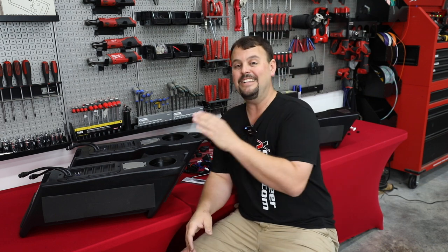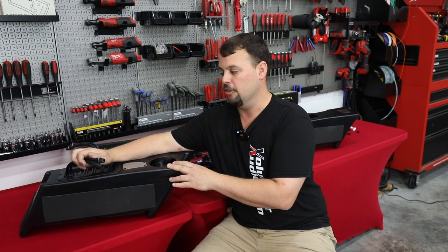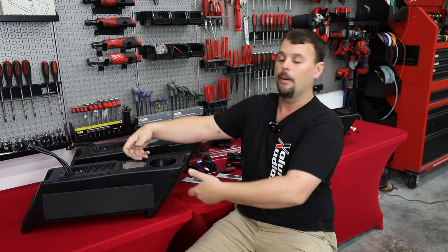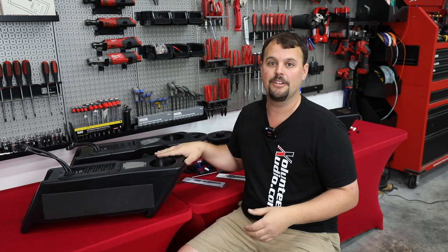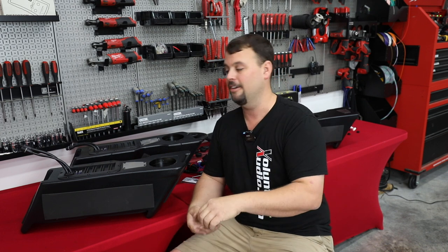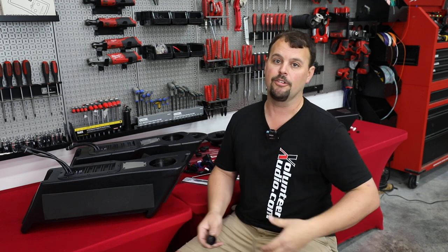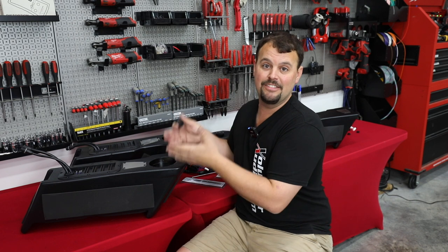On top of all of that, it's very easy to install, and even easier to uninstall when you take one of those long trips. If you're going to take a long trip and need to fill your bag full of stuff, you simply unbolt these two connectors from the side of the bag, remove the two latches — it's just four screws on each — pop that sub out, put your latches back on, put your bag back on. Really in about five minutes time, you can have this out and be ready to go. With these ingenious bushings, they have that hydrophobic cloth in there — you're not going to get any water in, but you're going to let air get out, which lets this sound get out. And your 6x9s are going to sound even better when you don't have these in than they do even now.